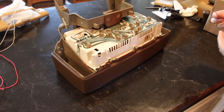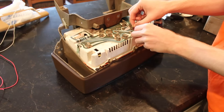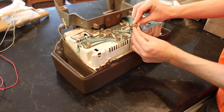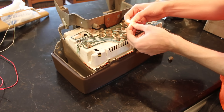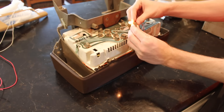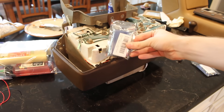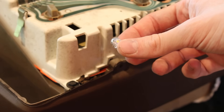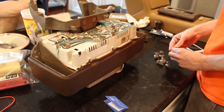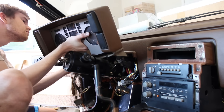Next was the instrument cluster, but there was an issue with the lights not working. There was power through the harness and continuity through all the traces, but still nothing for lights. Testing the connection at the bulb housing showed nothing, but when I pulled the bulb out and tested it directly it lit up fine. I figured out that folding the contacts of the bulb in half to stick out a little more gave better connection with the casing. However, some bulbs when tested burnt out instantly, so I opted to replace them all with LEDs. Since LEDs are polar, I used a wiring diagram to mark out which sides were going to ground and tested each LED before putting them into the board. It took quite a while, but it was definitely worth it to have visible gauges. With that done, everything was plugged back in and bolted back up.